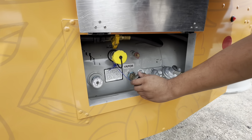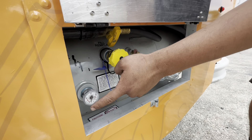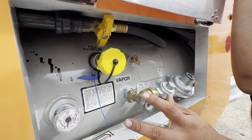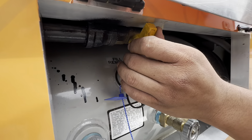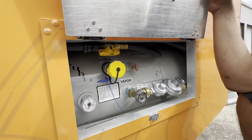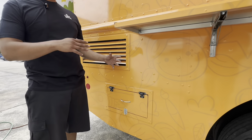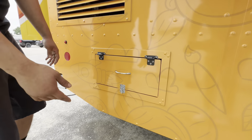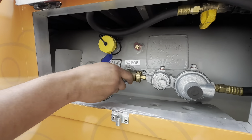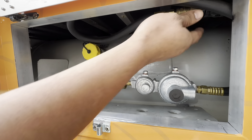When you're ready to turn on the propane, turn it on and check your gauge indicating how much gas you have. Once the main valve is open, it will start releasing gas inside the truck. On one side you have a propane tank, and on the kitchen side you have another tank — same concept. Make sure the valve is open and check how much propane you have.